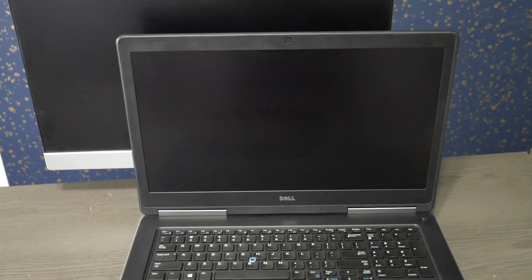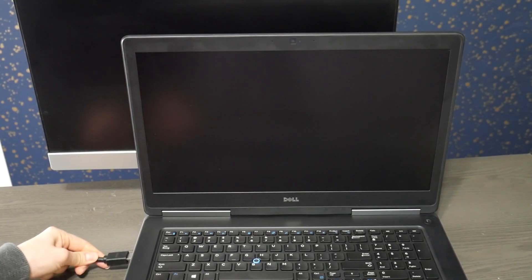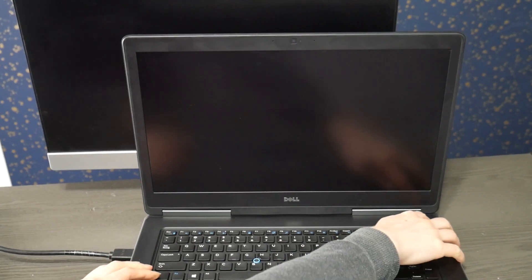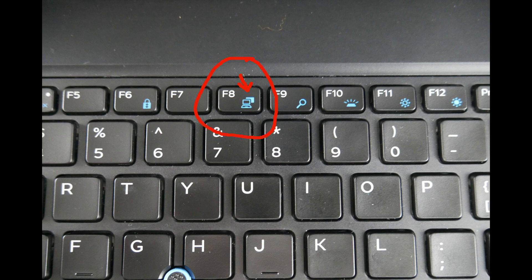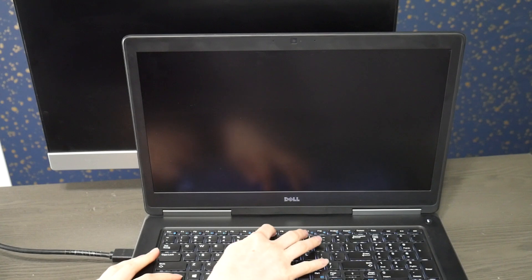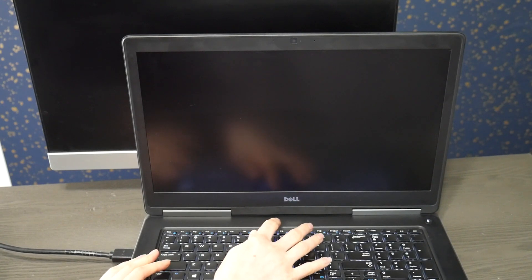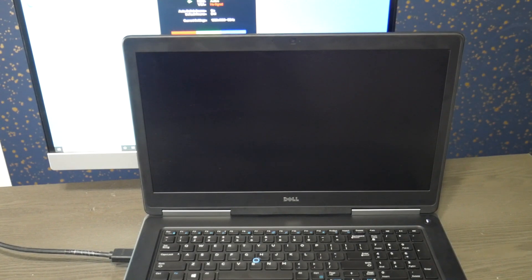Next up in the troubleshooting method, we're going to try hooking it up to an external monitor or a TV. I'm going to take my HDMI cable — or whatever cable you have — and hook it up to your laptop. Sometimes when you connect it before turning it on it will automatically display. Sometimes you have to use the key combination FN plus the function key that has the monitor icon on it, and hit them at the same time to force it to display to an external monitor. Sometimes it automatically displays when you hit power; other times you have to use that function key combination right at startup.